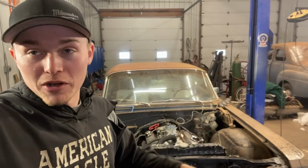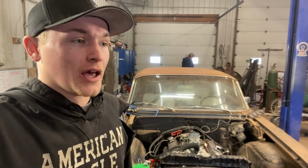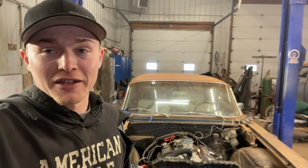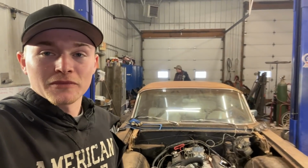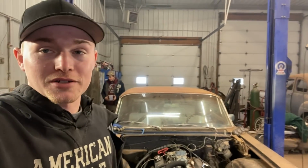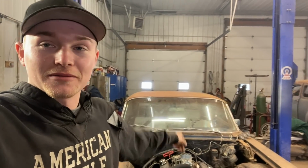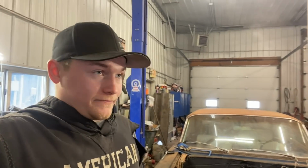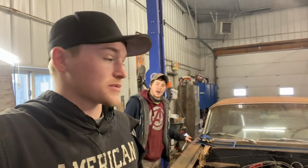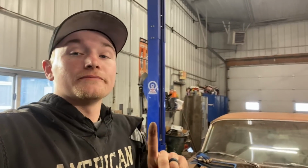As you can see, I was running water on the radiator to keep the thing cool. We don't have a fan on it. I've used that method many times, never had an issue with it. There's a temp gauge over there too. Been watching it this whole time. I know it has oil pressure because it was spraying everywhere, because those little plastic hoses that run to those things broke. It's broken like four times. So we're going to have to get a new line for that. But it's fine. Runs great.